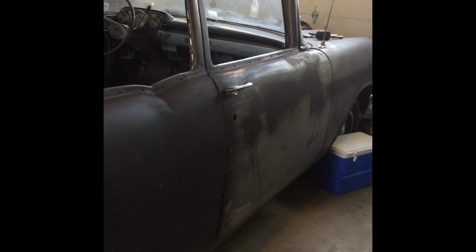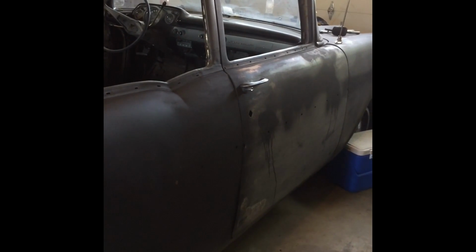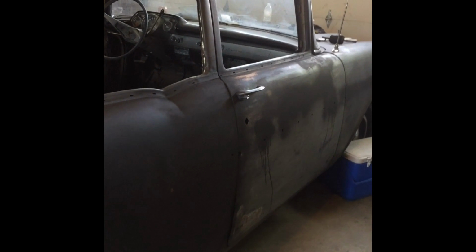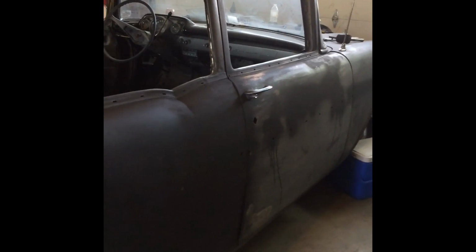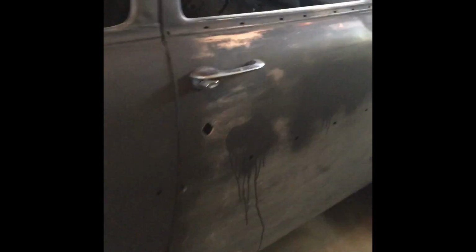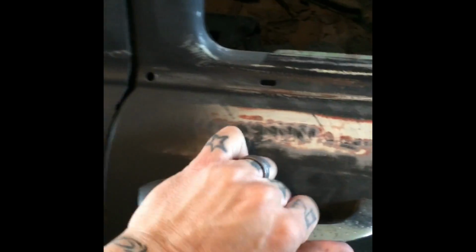If you made your door or if you got the 2-door doors, one thing that was really great based on the measurements that I had was these doors were really, really close. Based off the measurements that I took from the other door from the 2 4-door doors that I spliced together. There's one major difference, and I just want to show you really fast. The 2-door doors have this rolled edge that comes out. The 4-door doors are flat, and these ones have a roll out. Obviously, aside from that gap that the 4-door doors have here.